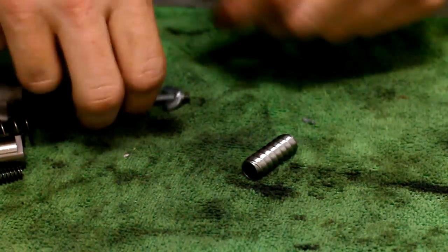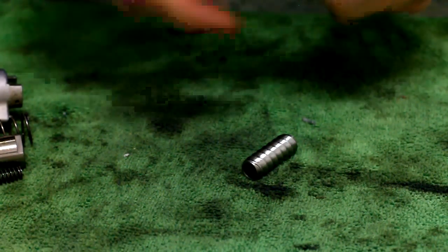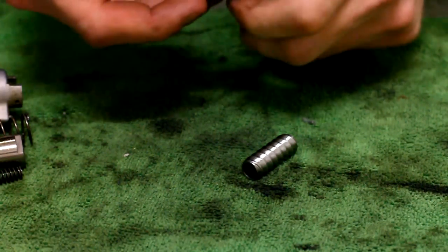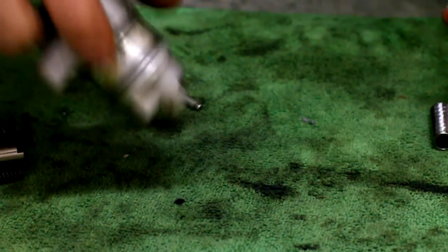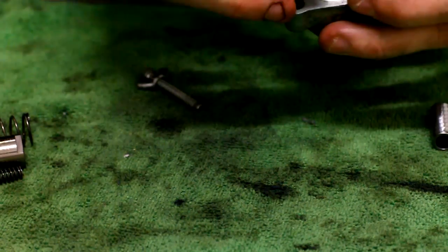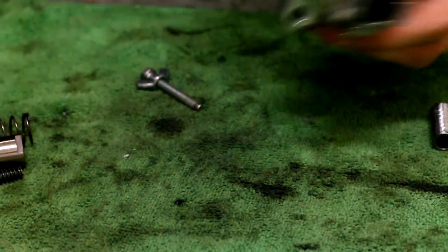I'm going to show you how to reassemble this whole assembly. Take that bolt from earlier and turn that wing nut pretty far up the bolt — by the way this bolt's about two inches of thread. You've got your plunger from earlier. A lot of people will clean it up and take all the oil out, but if you don't see any debris, I recommend leaving oil in it so everything's pre-lubricated. Or you can spray it out, clean it, and then just put a couple drops of oil on everything. You can use assembly lube too.